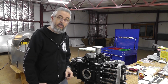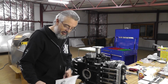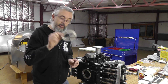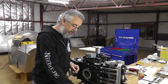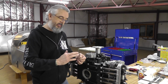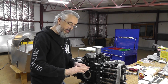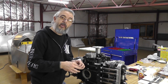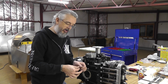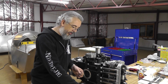But before we do that, we need a gasket. Same task, same method we used on the last job with the oil pump. We're just going to take some of the regular motor oil and coat both sides of the paper gasket, letting it soak in and saturate through the paper. That will create a little swelling in the paper or fiber material here, and once the sump is torqued into place, it should create a really good seal.